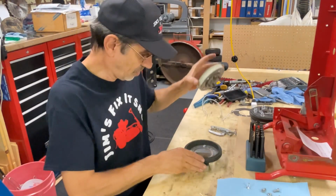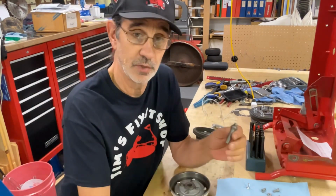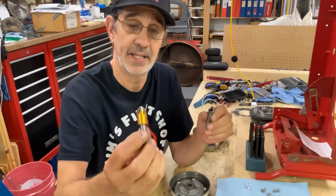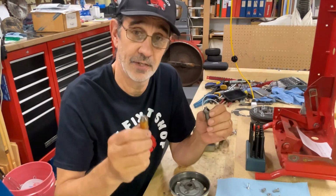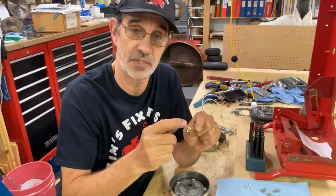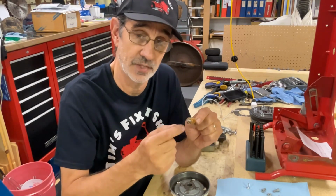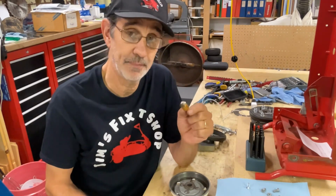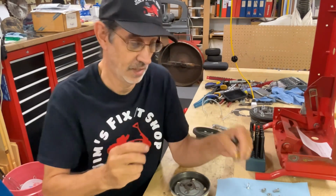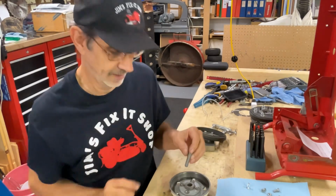Now you want to take this off, back to the drill press. I buy chamfering tools. This is a standard that everybody's probably got, and they don't do a good job. They chatter like crazy. And the reason they do that is because all 6 of these teeth are exactly 60 degrees away from each other. They're equally spaced. We make these at the shop. We stagger the teeth. They cannot be equally spaced. Once you stagger them, they'll cut and they will not chatter.